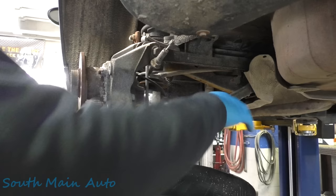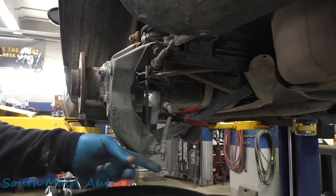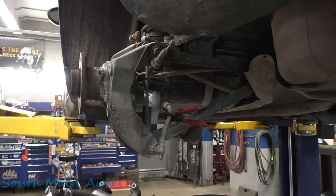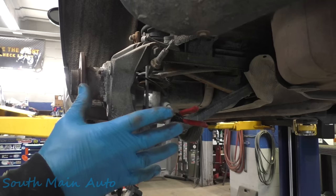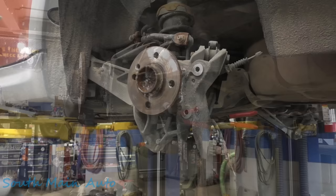Let me go get the comment generator — there she is, she should have its own music. I'm gonna put 7,000 pounds of pinching force against that thing to stop the drips. Yes, I know if I step on the brake pedal it'll also stop the drips. And this isn't a banjo so we can't stick a bolt stem in it. Hose pinch pliers work great and they don't cause any problems — believe it or not this hose will hold back about 3,000 PSI of normal braking pressure, so the one pound outward force to simply stop the flow is not gonna hurt it.